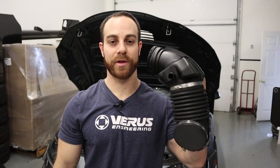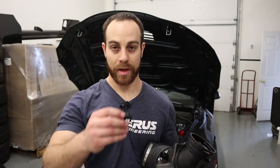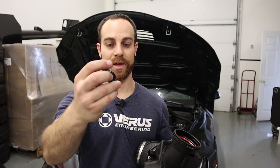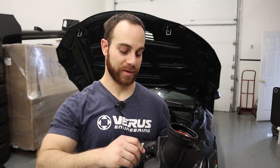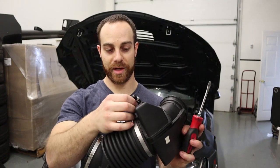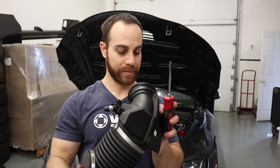Before we reinstall the intake, I recommend installing this piece that we basically took from the OEM part — we heat it up, cut it apart, and we include a nipple. With that nipple we can reinstall that, and then it is a sealed unit. Install one of our hose clamps there — we include a little worm drive — do that, and then the intake is ready to be installed, and the install is basically done.